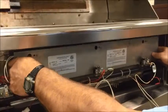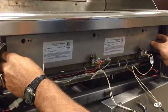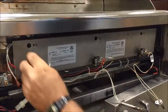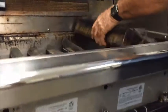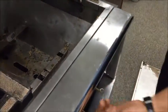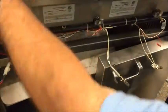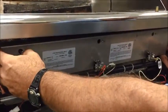Once you've got those two screws done, you'll notice this won't come off. If you try to take it off it won't come off unless you take the orifices off first. Get a half-inch deep socket and move the burner out of the way, then start taking them out — remove the orifice because it won't clear the heat shield when you try to pull it out. Do all three of them; we've already done it but all three need to be removed.